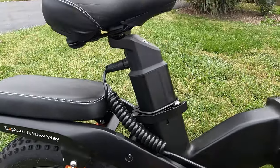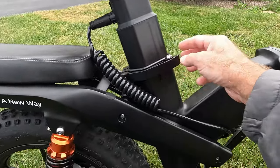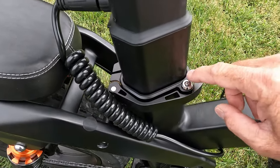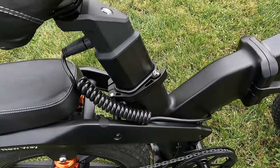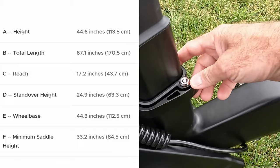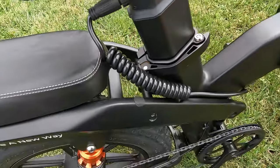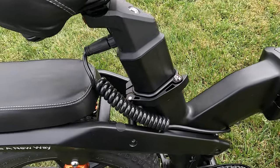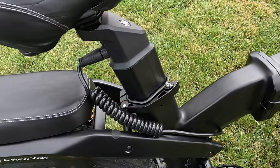This doesn't use a traditional seat post — it's got its own proprietary shape, a really heavy-duty seat post. It is fairly easy to adjust: there's a key you put in, the little pin pops up, which releases a lever you pull back to height-adjust. I'll put the minimum and maximum seat heights on screen. There's also a tension screw in the back you can tighten so it doesn't slip on you — by default it ships a little loose, so you'll want to tighten that. Once you crank the lever down, it locks the post into place and works perfectly fine.